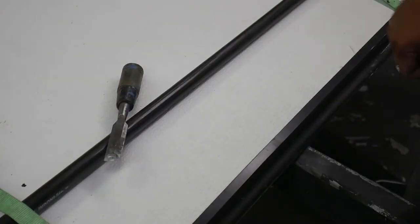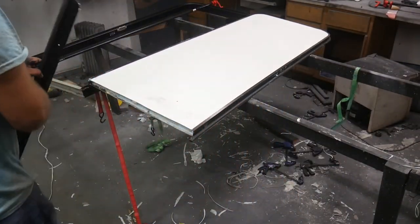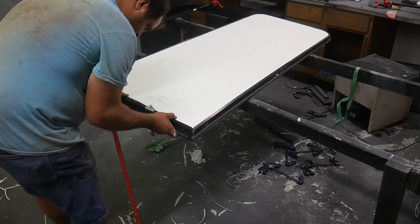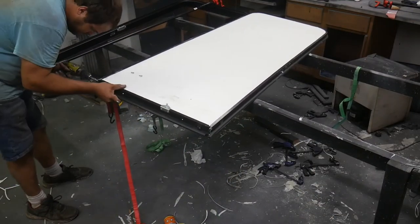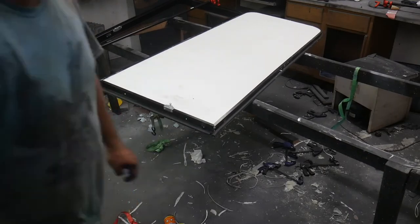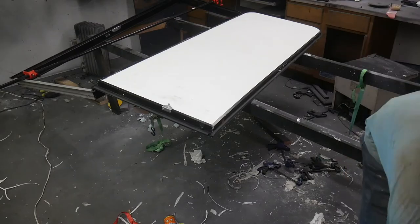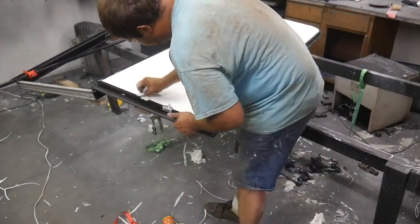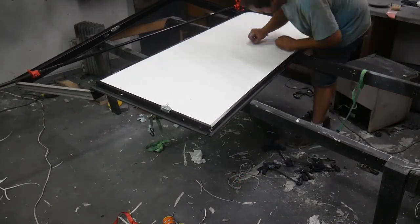And you want to make sure here, I've got a few ratchet straps and some clamps, and here I'm putting the bottom rail on and the screws. But you need to make sure to take some ratchet straps and clamps, whatever you've got, and pull in all directions to make sure that the inner frame is pulled tight against the door core. Here you see me working it. And it looks like it's all the way on, but when you tighten that clamp up, you can actually see it pull in slightly. Anyway, you need to make sure that is well seated.